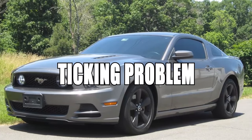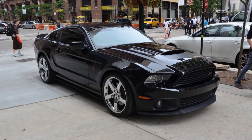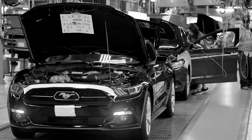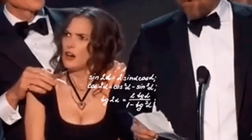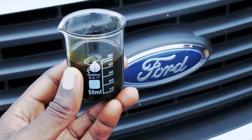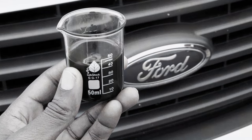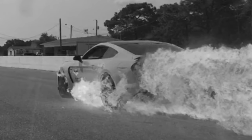With the 5.0s, there seems to be a ticking problem that typically happens after an oil change. Ford's service bulletin 7718 states it is not detrimental to the engine. However, there have been many cases of engine failures that Ford recognized in most cases and ignored in others. People say there was a bad batch of 5.0s sent out. There does not seem to be a true answer to this issue. Some claim using thicker oil fixes the ticking, but that will ultimately cause other engine components to fail long-term because the oil won't reach the entire engine as quickly as the manufacturer expects, and those engine failures may explain the reports of failure while the engine is ticking.